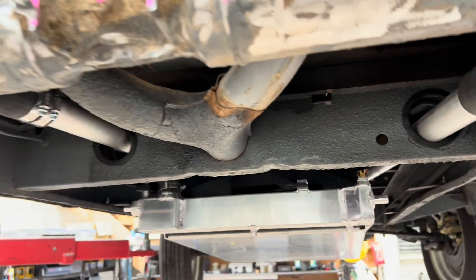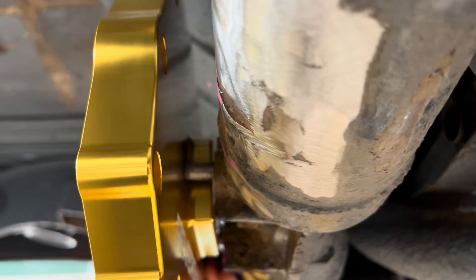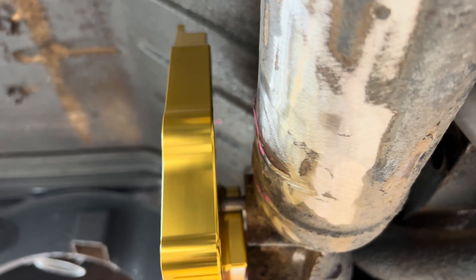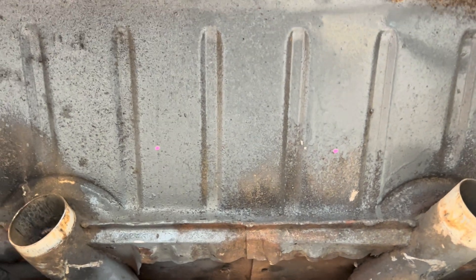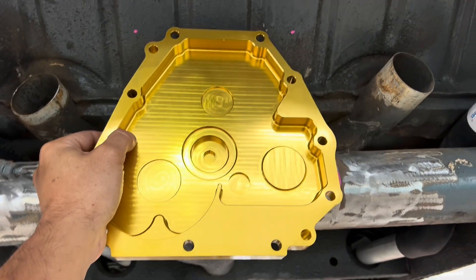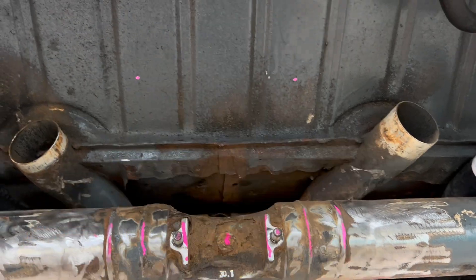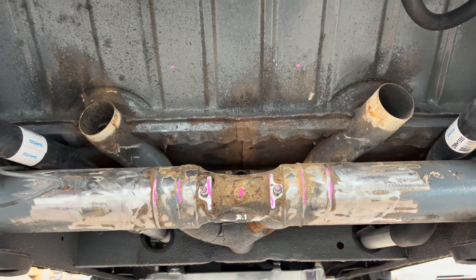And that's all because the end plate sits there. What we're trying to achieve is a three millimeter gap between the end plate and the torsion housing. As you can see there that's about 20 mil or so, so that needs to come in to being around about three mil. And then the two pink dots there - one there and one there - that's just a guide for where we've got to cut the floor, because this mount actually sits up in and would hit the floor if we don't cut it out. Then you just make a plate for the back of that, which is later on in the video.